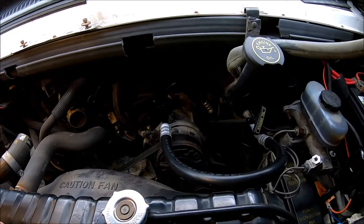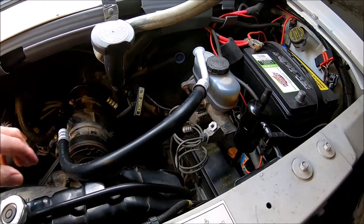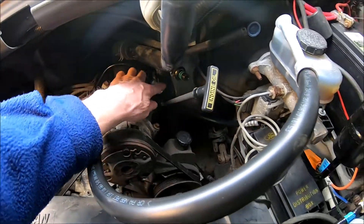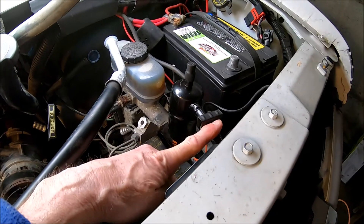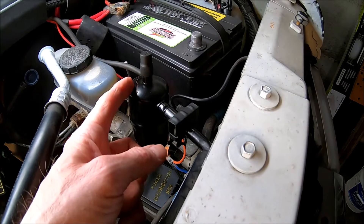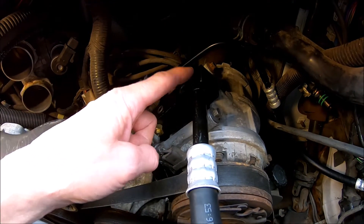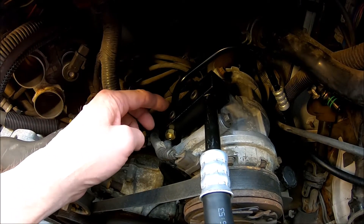Here's where we are so far. I've got this hose assembly right here — consists of this hose, this block, this pipe goes to this hose, comes up to this pipe, to this piece that goes on the condenser. I put two new O-rings on here and pushed it on, put the clip on. This already had two O-rings installed on it, so I just had to clean the surface on the pump.